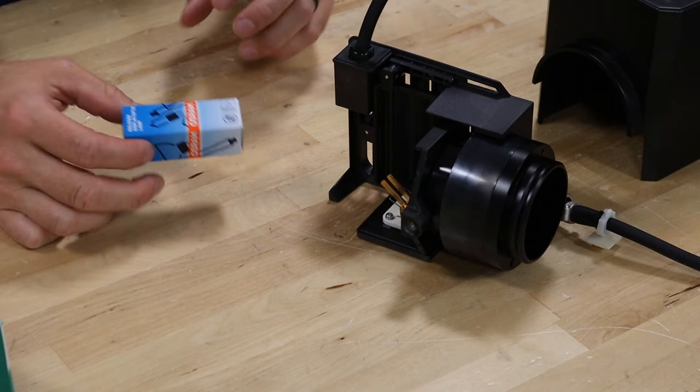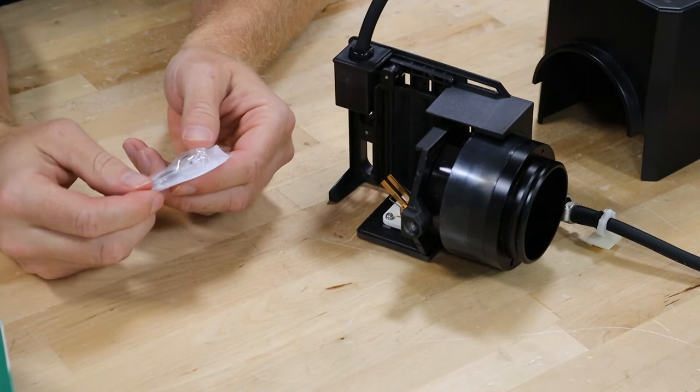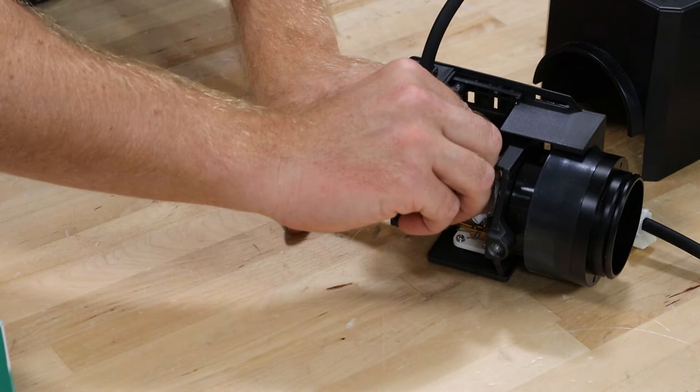Now that the old bulb is out, we're going to take a new bulb. This is an Osram 12-volt, 100-watt, it's a 64625 HLX. We're going to put that in the description so you can take a look at it. Go ahead and open up the packaging — if you notice the prongs are here on the bottom, you can open the packaging without touching the bulb. Then you're going to put this bronze lever down, then take the bulb without touching the glass and insert the prongs.